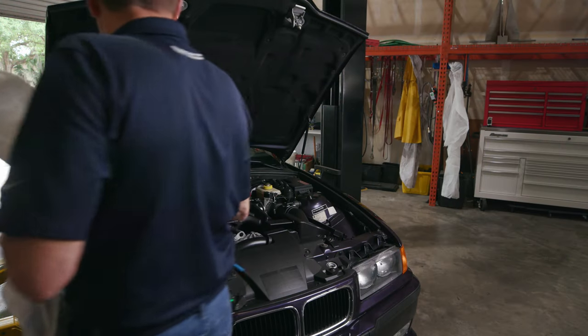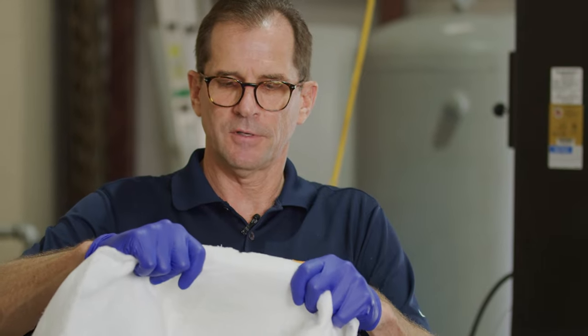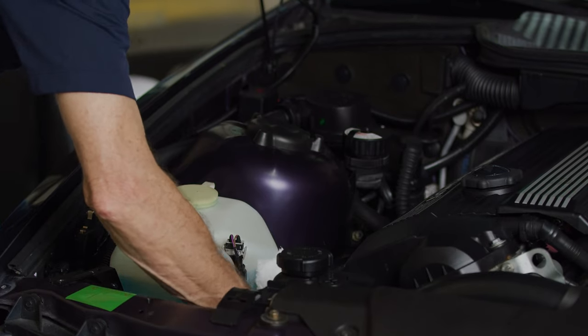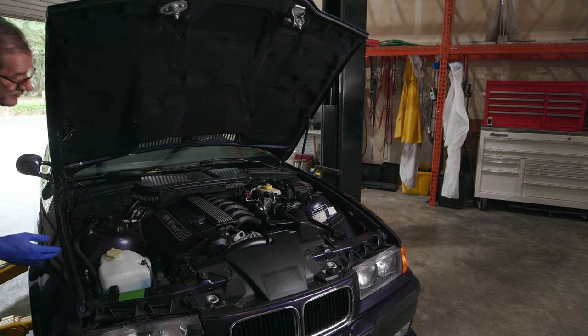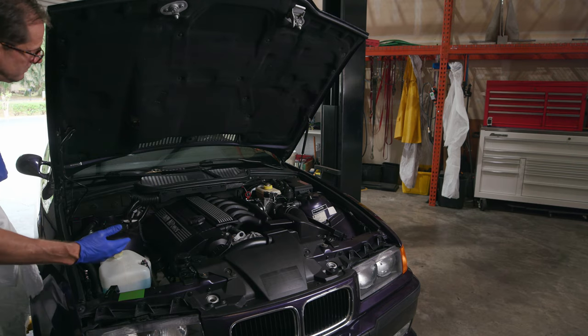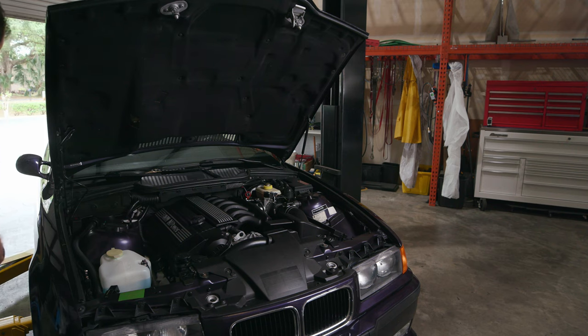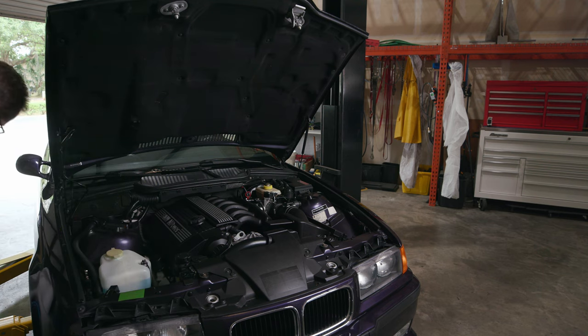Okay, back to the E36 project at hand. This is an oil absorbent cloth that's pretty easy. We used it in the marine oil recovery issue in water. We like to use this to stuff down in the engine bay, because if you think about it, I'm down there with crazy PSI and volume of air and I'm blowing dirt, and dirt's going somewhere. I want to make sure we're not running all the dirt up into the hood liner and getting it all over, as best we can. So we like to just tuck this away. It's one of those lessons we learned the hard way. You just make a lot more work for yourself if you don't do this.